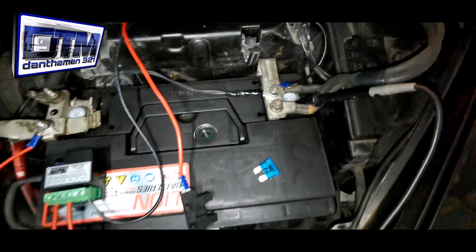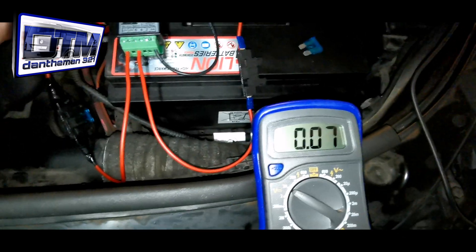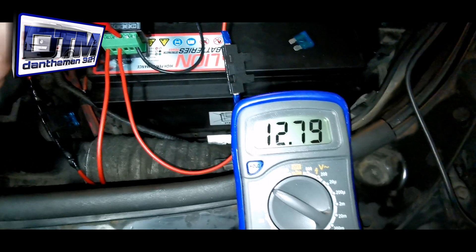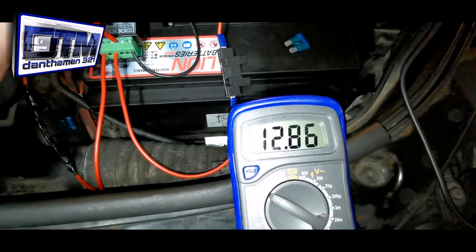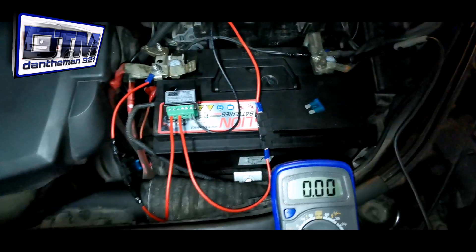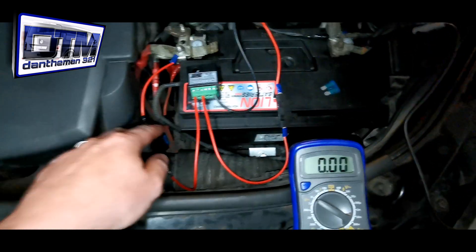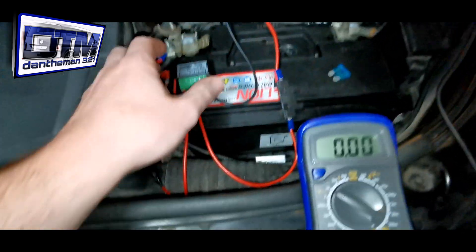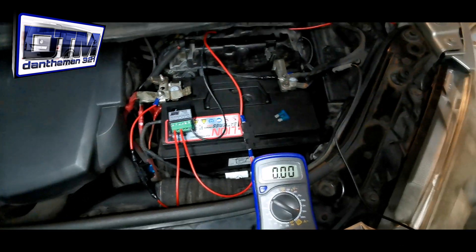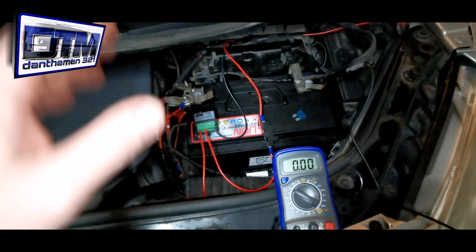Number four is a permanent live. So this is a vehicle battery reading at the first bank — we've got the same reading. If I move over to number four, as you can see that is a permanent feed, so we don't want to be using that one. We're going to be using number six — we could have used either six or two. So that's the setup: just those three wires, and we've got the two inline fuses, which are a must, as close as possible to the battery. These inline fuses clip together so everything stays nice and neat. I'll tuck this right at the back so it doesn't get affected by weathering. Now I'm going to tidy up under here, cover all the wires in convoluted tubing, and make everything nice and tight.